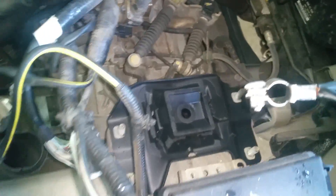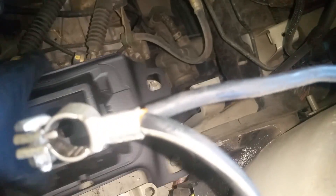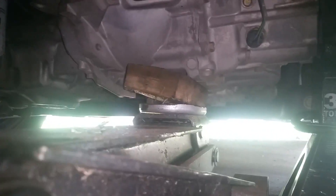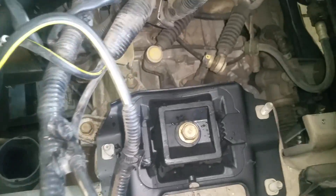The engine and transmission moved — it slipped forward. I've got my cherry picker over there if needed. I'm going to try to shift it back into position before fastening the nuts. I figured out what I did wrong — I was in the wrong location with my jack. I let it down on the jack stand and repositioned it up front because it wants to twist. I got a hold of it and it just pushed right back into position so I can get the bolt in. I put some Loctite on it and torqued it — I went 100 foot pounds on that; it's a big bolt.